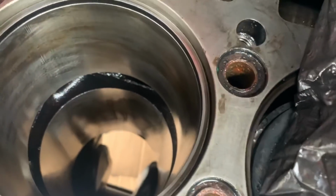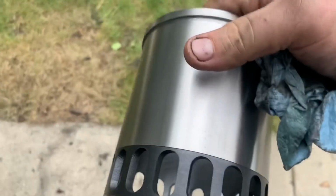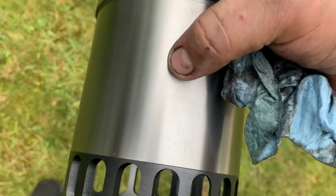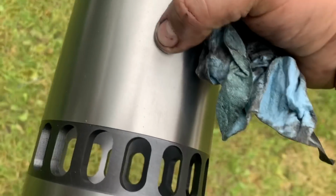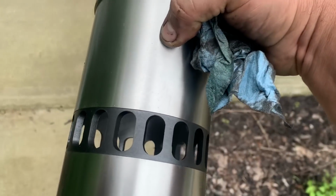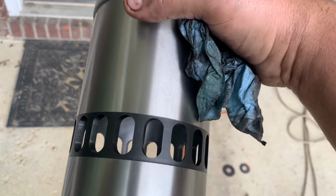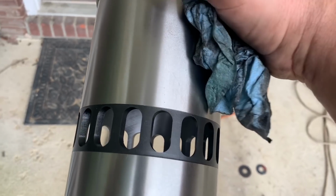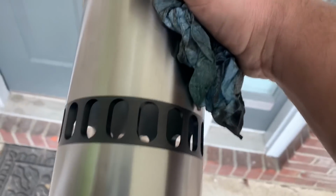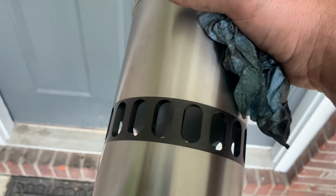71 series, this is a dry liner, unlike a 92 series, which is a wet liner, meaning that the dry liner on the 71 like this, coolant never comes in contact with this. So the coolant's flowing through the block, this is touching the block, and that's how the heat gets taken away. A 92 series has the wet liner where there's an O-ring on it, and coolant actually flows up against the inside of it. So it's better at cooling, but it causes other issues. You have more problems with cavitation, you'll get holes in your liners, things like that. I personally like the dry liner better, but it's just a choice. I think the 92 series does cool a little better, but there's more issues with them that I've seen.